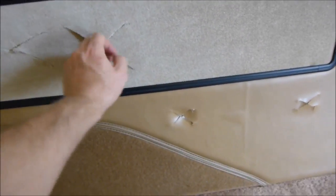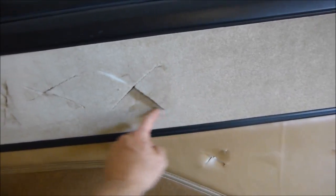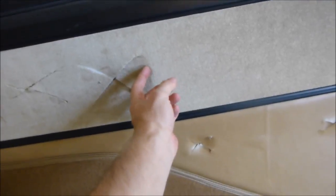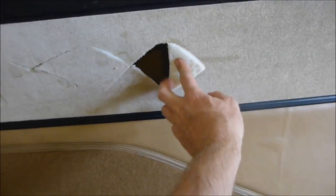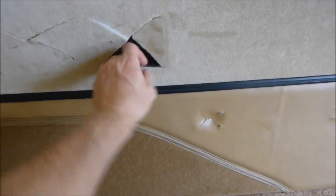So that's it. That's how you install the door panels to the top pillar pieces, and how you add the L trim and do the cutouts. So always cut out like this. Please don't just cut here. You'll regret it, because the sun will hit that little plastic cover and eventually this will peel back. It'll peel back and then you'll see the foam padding peeling back, kind of like that. So keep this longer and just fold it in. Okay.